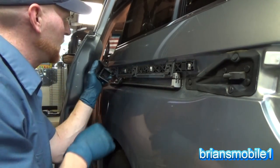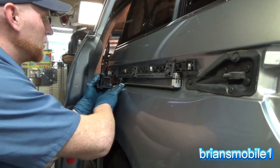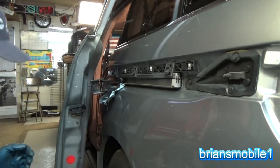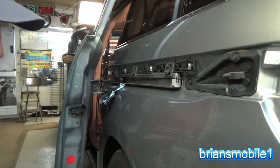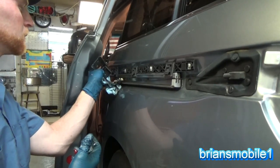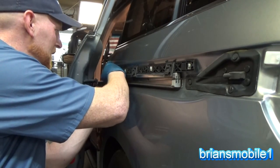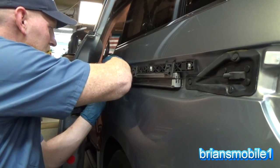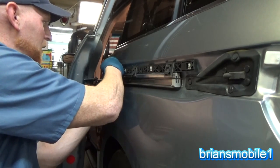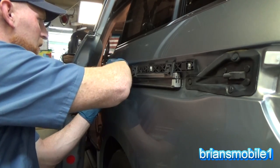I'm just going to set it up inside of there for now. Then I'm going to go get some grease and grease a few things. Then we'll slide the door back in and put the bolts in it. I like to grease around the wheels, especially. The less they get stuck, the better. So I'm going to push a bunch of grease all over the top and try to get it down in that, down on that axle line. Grease just anything and everything, really. But mostly around the wheels because they'll distribute it up in that track where it's hard to get with your finger.